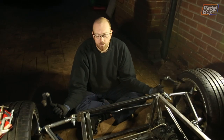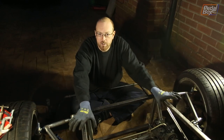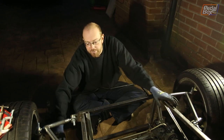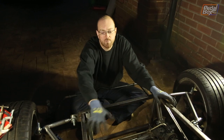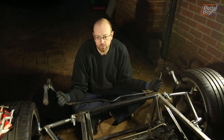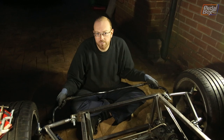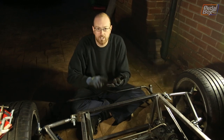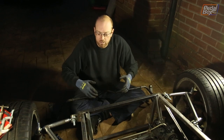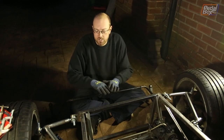There is another way. If we mount this above the rack where we had it before, it makes all of this area very, very busy, and we haven't worked out exactly where our coilovers are going to go — obviously they're going to have to come from here and go somewhere here, but that's about all we've got. If we mount this onto the front of the suspension and have this all the way out here, we don't have to go out of our way to build anything extra. We still need to mount the lights, the bumpers, the radiator, and everything else further forward of here, so we still need to build structure and we don't go out of our way to build anything unnecessarily, but it does simplify our life.